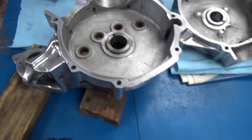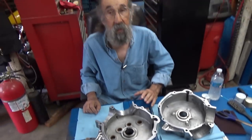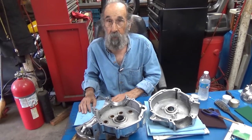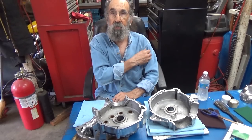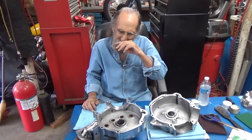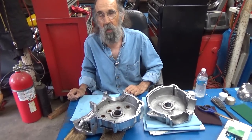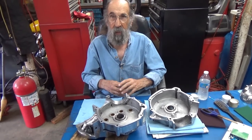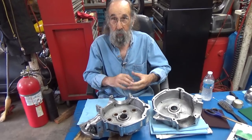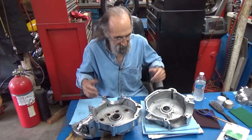I was looking at this today and thought I really haven't cleaned that timing plug thread very well yet. When you're running down the road in a hundred-and-some degree weather and the motor is running who-knows-how-many degrees and you're doing about 80 miles an hour, and all of a sudden that timing plug blows out and hot oil blows all over your leg — I guess I should have looked at those threads a little better. That's when you go to an auto parts store and find one of those do-it-yourself oil pan plugs for when you strip the drain plug. You get one of those rubber things that expands in there — they work in timing holes on Harleys too, and you can get home. Word to the wise.